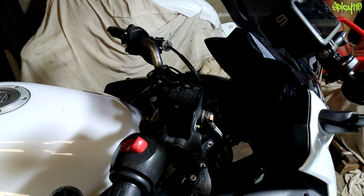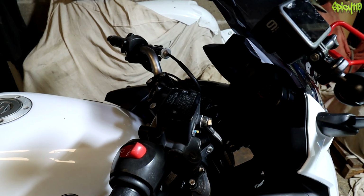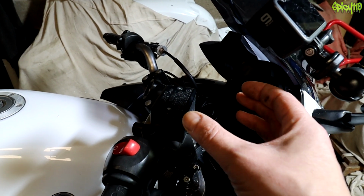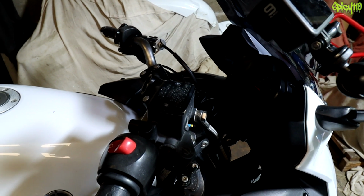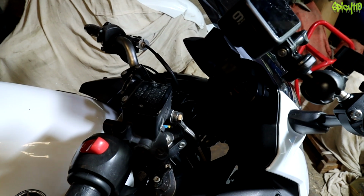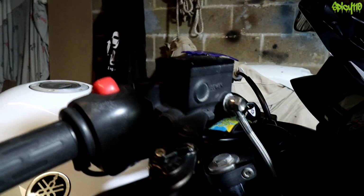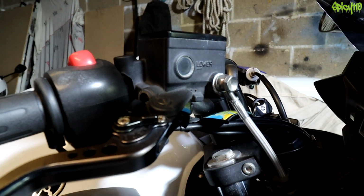It's also more likely to cause boiling, which is where it's got so much water in it that when the brakes get hot they boil and they clamp the brakes on. Not a good situation. So this is one of the many reasons you should change this. It improves feel if it's old, and it can be a safety issue if you don't. Also, you need to make sure you have enough, but I definitely do. I just don't know if it's any good.